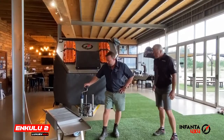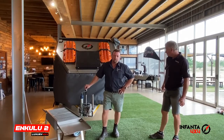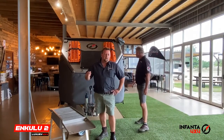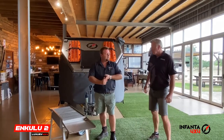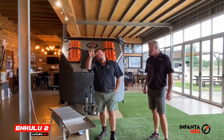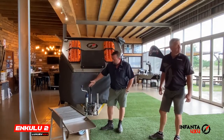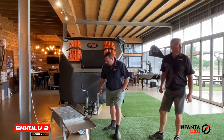Right. In front of the caravan, very important to remember, it's got an auto reverse brake system. So anytime when this caravan moves back, the brakes will release for you to reverse in the sand and up hills. So when you off-hook it, it's standing on a hill, it will run backwards. This is the position for the brakes, the handbrake to be on. Just pull it down and it's released.